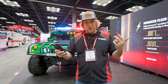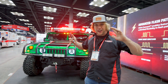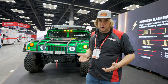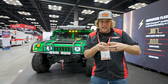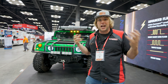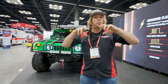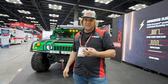We do responding modes, and once on scene, we can do a parked mode that has something called a soft flash — a flash that goes from zero to a hundred and back to zero — at a ramping rate you can define, enabling really soft nighttime modes. Now, one of the questions we get asked all the time is how many flash patterns does it have? We have seven core building blocks that work almost like music — you can put one flash pattern next to another, whether it's a single flash or a double flash. You can use these seven building blocks to design whatever flash pattern you want, set any speed, any intensity, and these are super configurable but with constraints so you don't end up creating a non-NFPA compliant pattern. The truck knows how many modules are on it, how bright each module is, and which colors you've chosen, and it gives you the ability to modify all flash patterns within NFPA guidelines of speed, rate, and intensity.